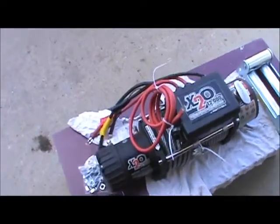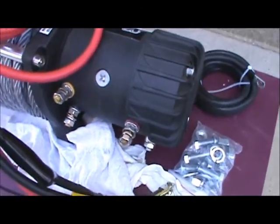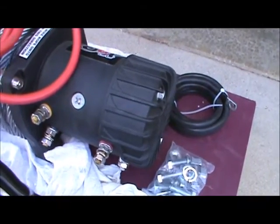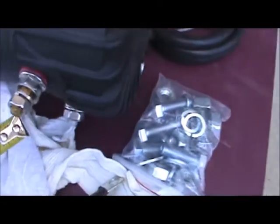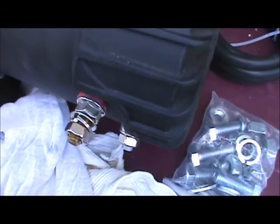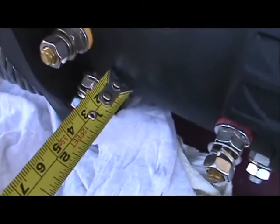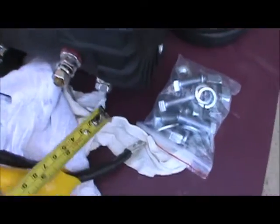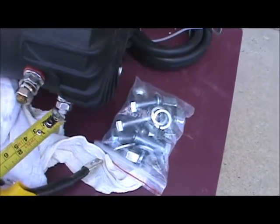The other thing I want to point out: wire everything up before you put the winch in — it'll make your life so much easier. When you're wiring it up, they give you a wiring schematic, and they also make it pretty foolproof with color-coded rubber boots. You have a red boot and a red seat — that's where that goes. You've got a yellow seat and yellow boot, a black seat and black boot. Then you've got your long black lead for ground, which goes to the battery.